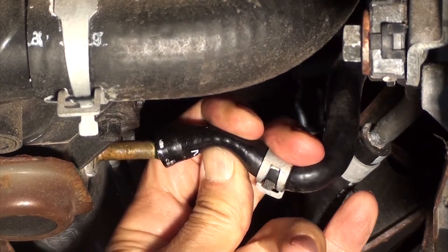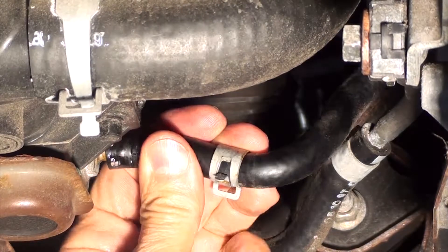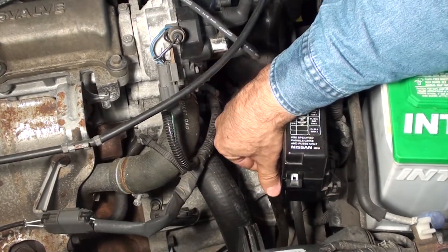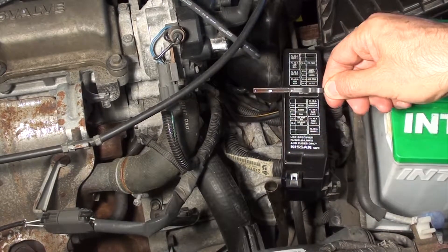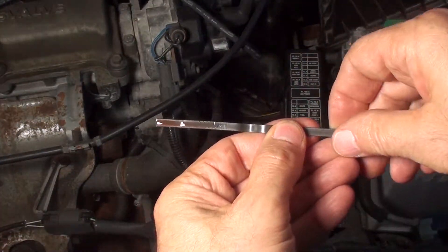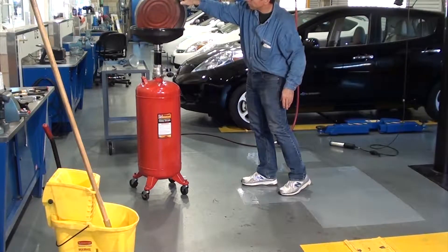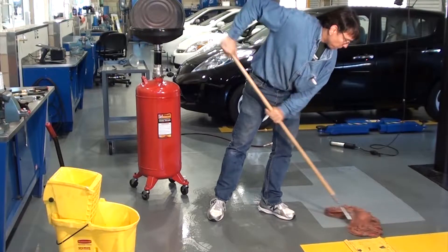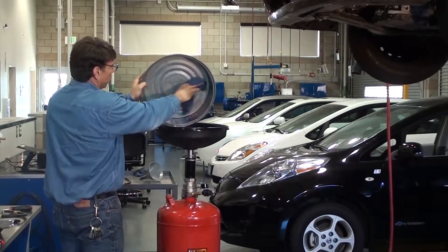When you're done, remove the sensor and reconnect the cooler line. Position the clamp in the proper position. Check the oil level in the transmission to make sure it's proper — the level should be right up to the proper level for being hot. Turn the dipstick back to the original position. Pick up your drain pan and let it drain into the oil drain. Clean your floor, then clean your oil pan, making sure to dry it out properly with a rag before putting it away.